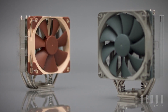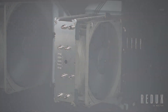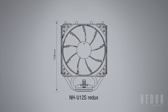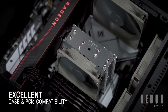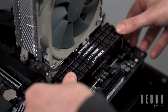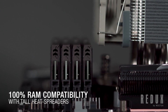Visually, the two coolers look very similar, and with the same dimensions as the standard NH-U12S, the U12S Redux inherits many of the benefits of the original. Standing at 158mm tall, the NH-U12S Redux is short enough to fit in most modern mid- or high-end tower cases, and at 125mm wide, stays clear of the top PCIe slot on most standard ATX or micro ATX motherboards. Also, thanks to its slim design, it won't overhang the RAM slots on any current platform, giving you full access to the memory modules, and guaranteeing 100% compatibility with modules that feature tall heat spreaders or RGB lighting.